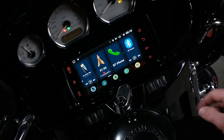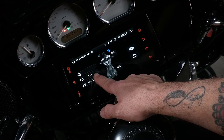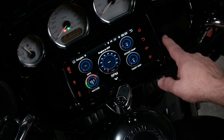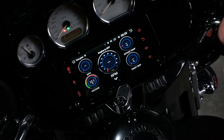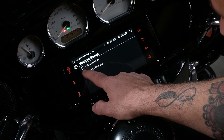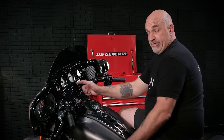Going back and hitting our home button, we can scroll over to our motorcycle info, tap that, and you'll be able to see what your bike is doing. Right now the battery is at 12.1 volts, low beam is on. If I flip it to high beam, you'll see that the high beam indicator comes on, then back to low. If I get out of this and go into my gauges, I have a full set of digital gauges that include mile per hour, voltage, RPM, intake temperature, and the twist grip. Going back out, our auxiliary control is the actual vehicle setup — we can go in and change some of the features in the Maestro itself or in the vehicle settings, such as whether you want to show the low fuel alert on or off.